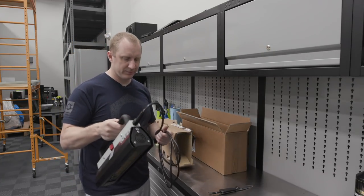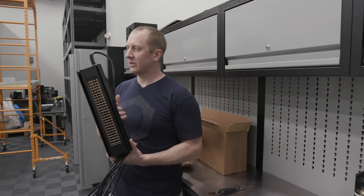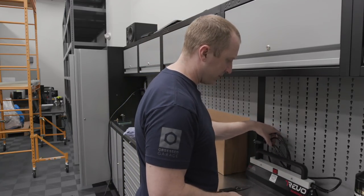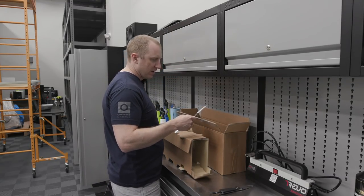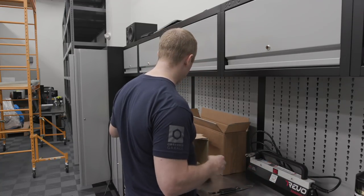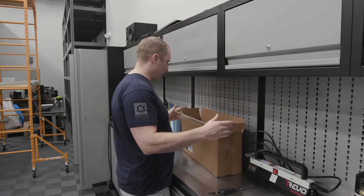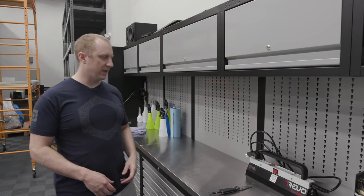Yeah, and so we'll just use this to heat up the paint. I could use this to cure the coating on here, but that would be kind of difficult to sit there and hold the darn thing. But I mainly bought this so that I can uniformly heat the M3's paint, rather than just pulling it out in the sun, because then I can't control the temperature. So with this, I can use my Fluke thermometer and control the temperature that I'm getting and hopefully ensure that I get the water spots out that I have.